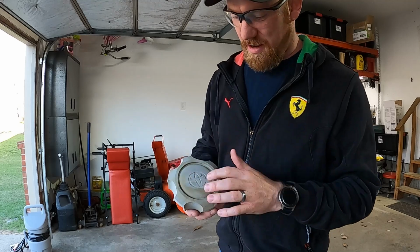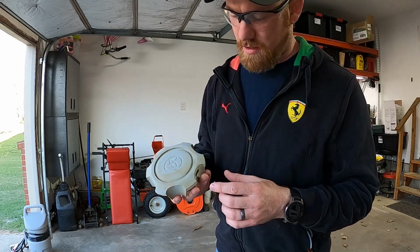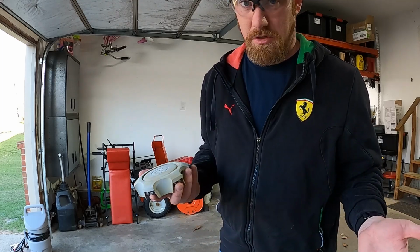All right guys, here we go. I actually sandblasted it up pretty nice. It gave it a little bit of a textured finish. I think the paint will stick really nice to that. So I'm going to clean this up. Well, I got to do the other 3, but I'll clean this up with some prep spray and then should be able to spray it.